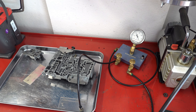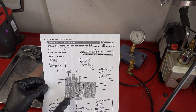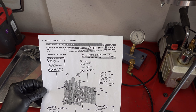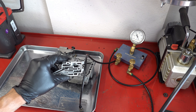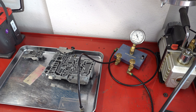Here's what we're going to test: the 4-spool switch valve, the pressure regulator valve, the downshift or kickdown valve, and where I can, the 1-2 and 2-3 bore plugs, and the 2-3 shift valve. These 4-speeds have a lower valve body with 3-4 quick fill and timing valves, along with TCC apply and timing valves, which these 3-speed transmissions obviously don't have. So our testing is going to be limited. I'm going to try to test the lockup module — I've never actually tested one of these before, so it'll be interesting to see what we can learn about the valve body's condition with this VAC test equipment.